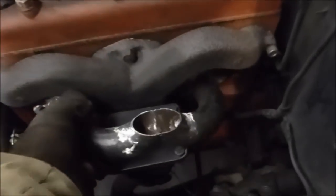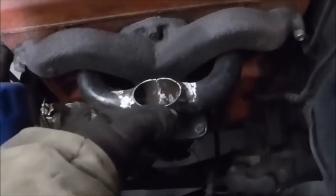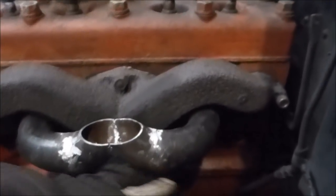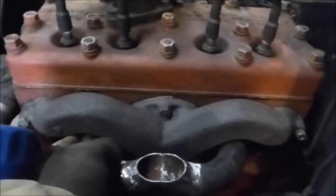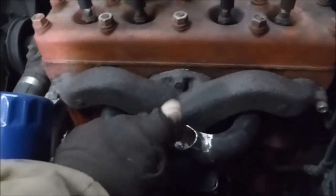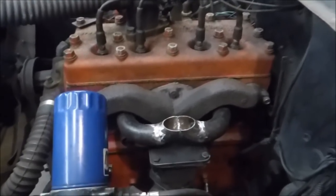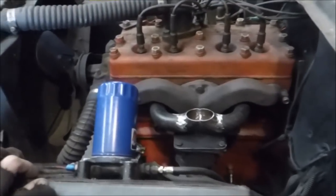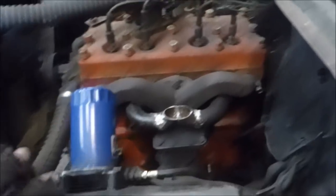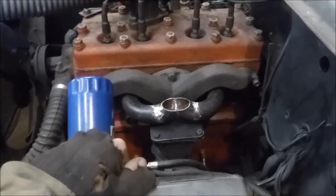I had to keep it pretty low profile so it fits under the hood scoop. It fits in here nicely with a good gap underneath. It's still going to heat up a little bit, but most of the heat will be away from it. You do want it a little bit warm to keep the fuel atomized - around 100 degrees is fine. Some manifolds are water-heated with coolant running right through them, and that's a bit too hot too. You don't want it too cold either, because the fuel starts condensing, the droplets get too big, and that kills your horsepower.